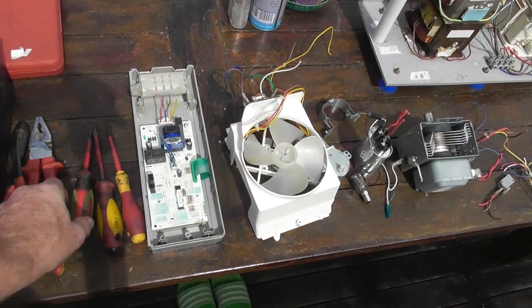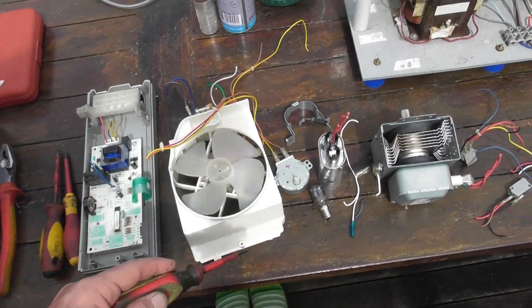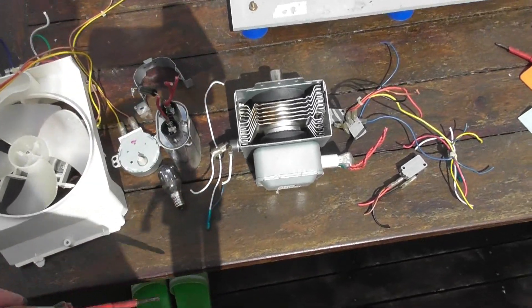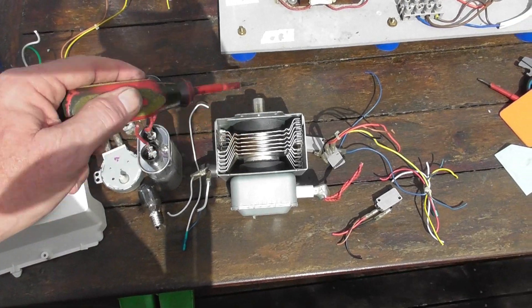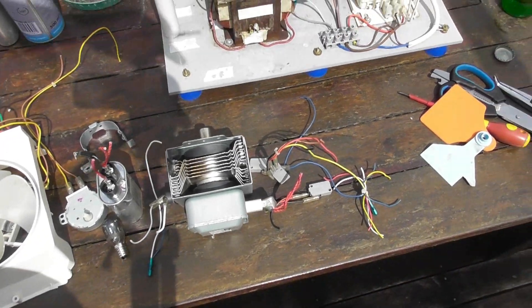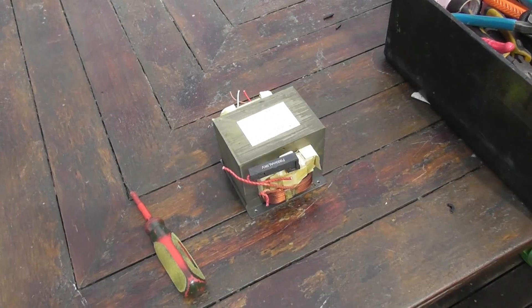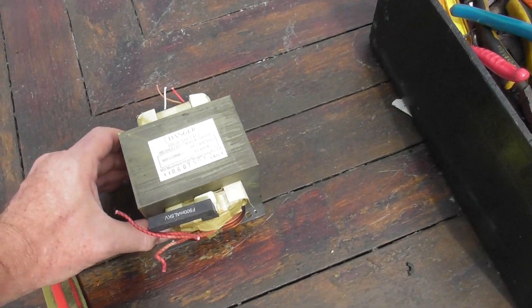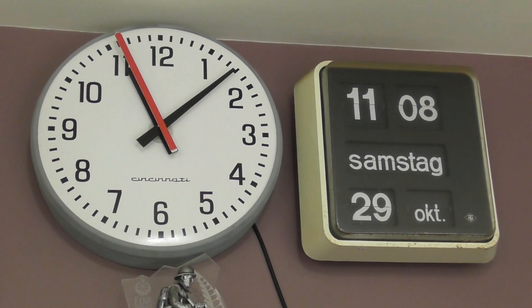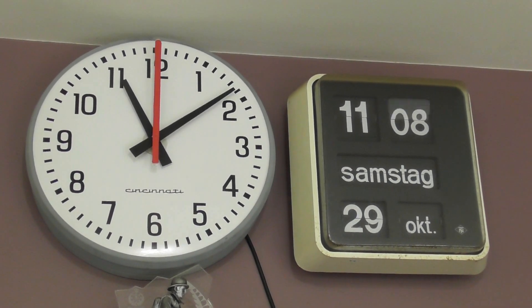A summary of what you get out of a microwave oven: timer board — might be usable; cooling fan; synchronous motor; capacitor; high voltage diode; lamp maybe; magnetron — usually two good magnets in there; a couple of micro switches. Most importantly — I nearly forgot — the mains transformer. This is a nice grunty one, 1100 watts. All in all it was under an hour and I was not in a rush to get this thing disassembled. Thanks for watching.